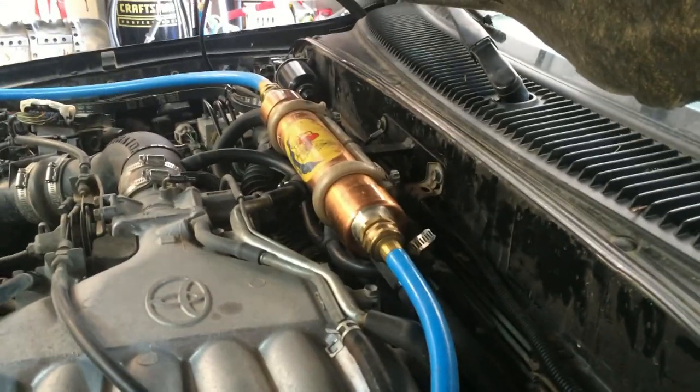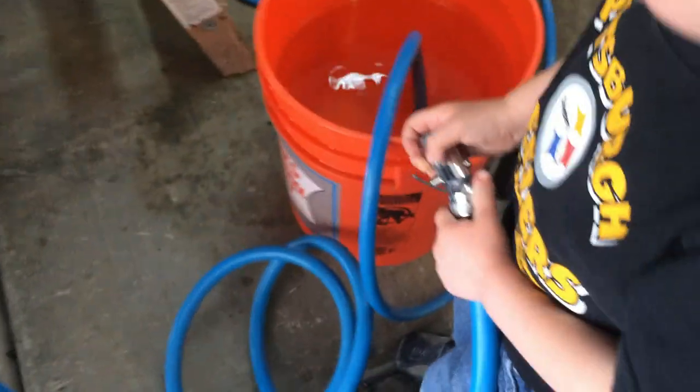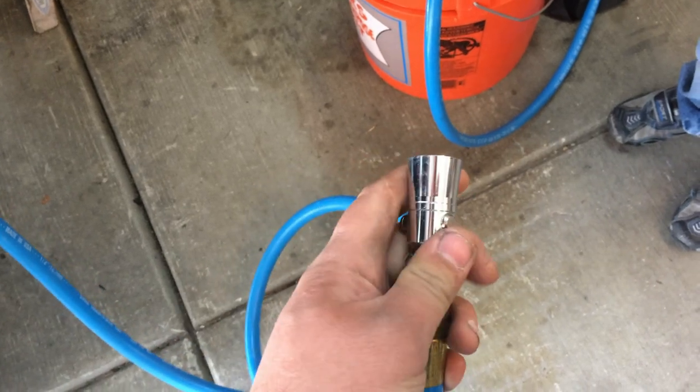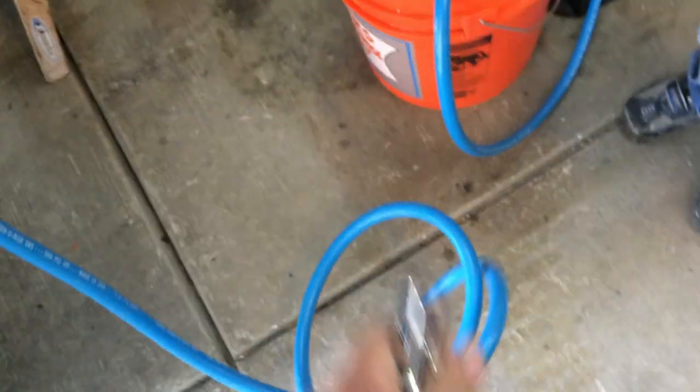That's where the magic happens — where it turns hot coolant into hot water. It comes down the other side and down this hose. On this hose I've got basically just a shower adapter. One way it's on, and one way it shuts off. That way when you're out, you don't have to use a lot of water — you can shut it off, soap up, do whatever you need, and then rinse off when you're ready.